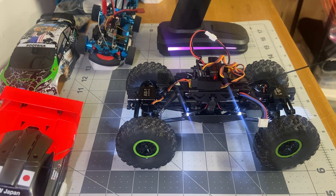This is my first step into the crawler stuff. This is an AX24 XT or XC1. I went through some headaches this weekend because I couldn't get the factory Spektrum 2-in-1 to bind to the MT12. So I ended up tearing the car down — now it's got a micro brushless system in it and the receiver that came with my MT12, which will also give me a chance to test that receiver for range.